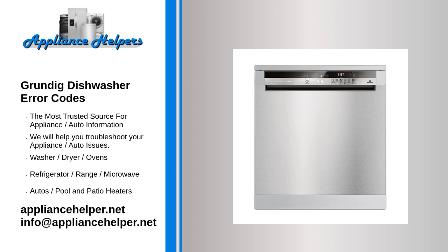999: Possible leak detected on models with floor protect with alert feature. For all others, the unit's control needs to be reset. Dishwasher floor protect is a leak protection feature — the dishwasher will not start; contact service. For all others, reset the control if the 999 error code appears in the display.